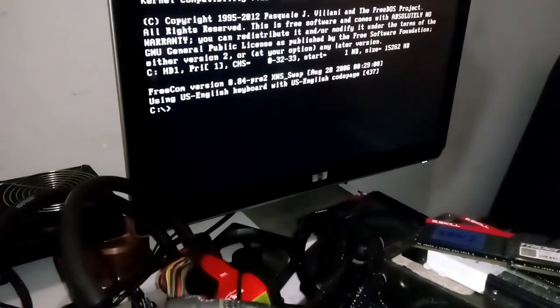And then I'm just going to hit the power switch on the PSU because I don't need to be here now. And I'm going to swap some stuff and I'm going to show you how the BIOS operates. Now me personally, I like to take it a step further and I like to hit the clear CMOS button or put the jumper on. So I'll put the jumper on. I'm going to set this thing up with my overclocking setup real quick. And I'm going to do a full-blown balls to the walls overclock, no baby stepping from BIOS, just to show it in practice. So pull the clear CMOS back off, all set, memory's loaded up, fire this bad boy up.